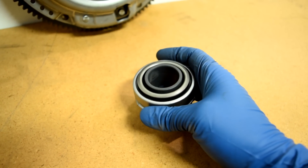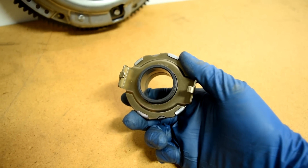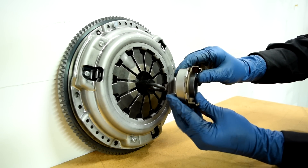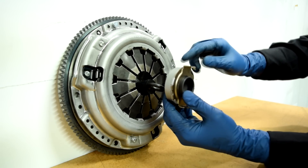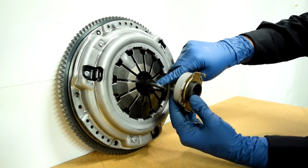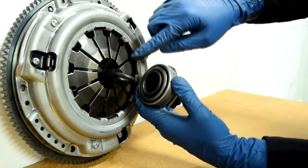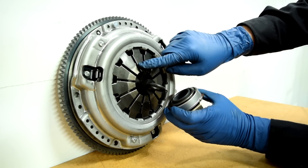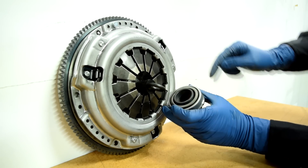If you have an old school mechanical clutch release setup, that bearing is called a throwout bearing, which is what we have here. The way these old school mechanical setups work is that this throwout bearing is engaged through a fork which is attached through a cable to your clutch pedal. When you depress your clutch pedal, that fork presses down on the throwout bearing, which in turn presses down on the fingers of your pressure plate. You need the bearing here — whether it's a throwout bearing or a clutch release bearing — because this is stationary when it engages the fingers on your pressure plate, while your pressure plate is turning with the crankshaft and the flywheel.